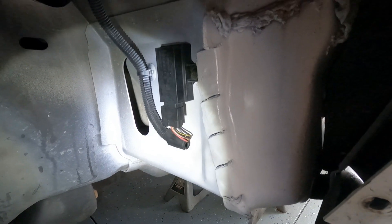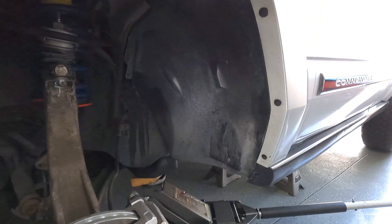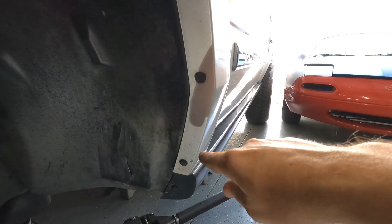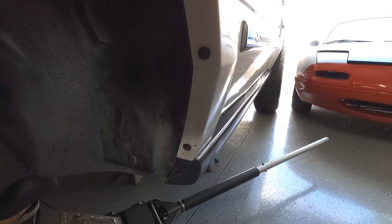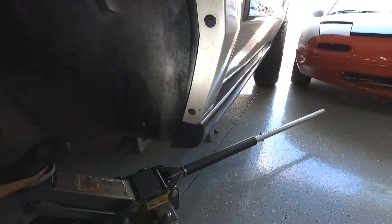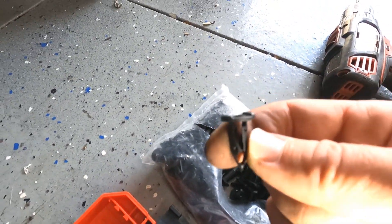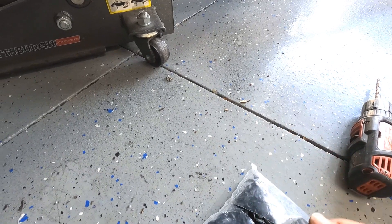It turned out pretty darn good. Now all I've got to do is reinstall the plastic liner — driver's side's done. Now in order to do the rivets here, you could do it the Chrysler way — buy their rivet gun, buy their rivets — and you'd have the same problem where you can't reuse them. Or you could do it the smart way and use these push-pin fasteners that hold together basically every single piece on every Japanese car. These things are reusable. I've got a bag of a bunch of them right here — I'll put a link in the description. You get this guy, then this cap goes on top, and you can pop it out and reuse it — super simple.